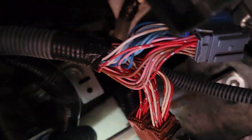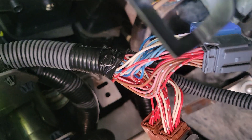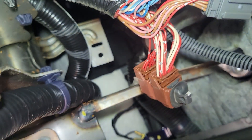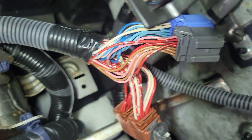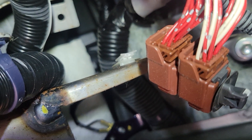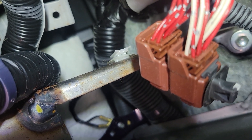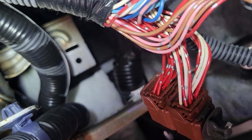You can see the wiring and all that right here. There's one of your bolts for mounting the steering column. Straight up underneath, directly above the brake pedal, is where you're going to find this module. Now this wiring loom right here straight ahead of the camera is in the way — it has a little plastic tab that's mounted right there, that little white spot right here next to that plug, is where the wiring clip hooks to. I just moved it out of the way in order to get to the module.